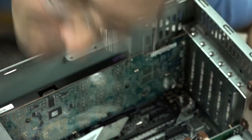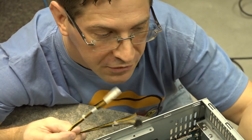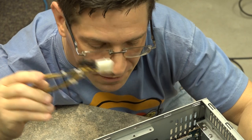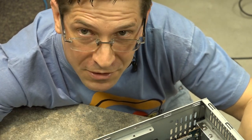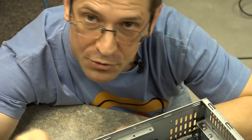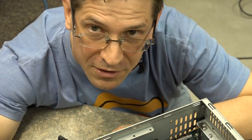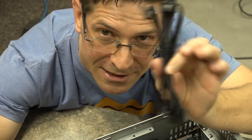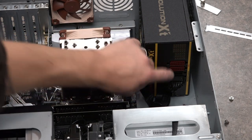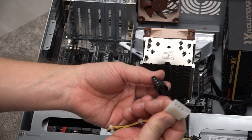Now we need to connect the power supply. I should point out that the power supply cable for a PC is different than that for a Mac, so if you ever buy yourself an HDX card, don't throw anything away — you may someday need this little PC assembly right here. Now here's another reason why I love Sweetwater's computers: this is an older style power supply, and their newer computers have a newer style that doesn't have this same type of connection. But Sweetwater was thoughtful enough to include an adapter that you're probably going to need. So here's our power supply right here — connect right in here — and now we find the right connection for our HDX card's power supply.